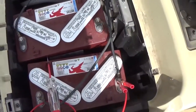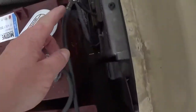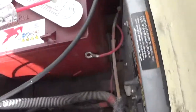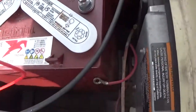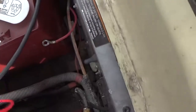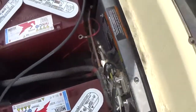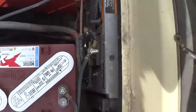Don't try this at home, folks. Not my best work, but because the batteries don't sit in here, I made a little extension for the ground cable, just to see where we're at. I've got everything hooked in a series and if all goes well, we should have about 48 to 52 volts. We've got 49.6, which is perfect. We can hook our positive up and that'll give us our power, and then we can take it out of the tow-run position and see if we've got movement.